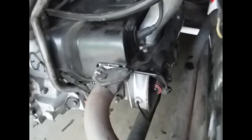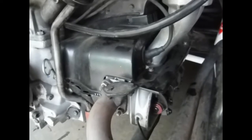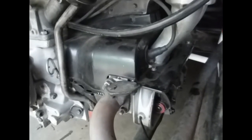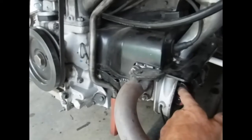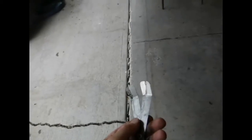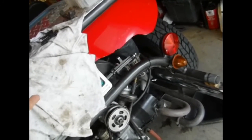Here's where it broke off. These are ratio rockers, 1.4. You always want to check for coil bind whenever you're putting anything non-stock on — don't just do the math and figure you've got it made. Put feeler gauges in there and check the springs, rotate your engine during your pre-assembly trial build. I double-checked it with a feeler gauge: stick them between the coils on the spring, keep adding until you can't get it in anymore. This came out at about 70 thousandths, so there's plenty of space on the spring.